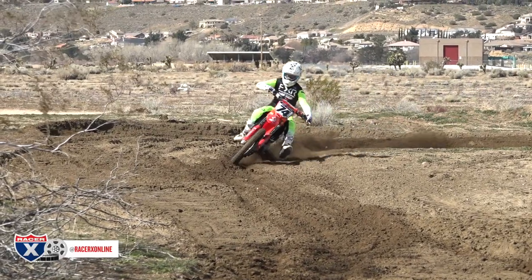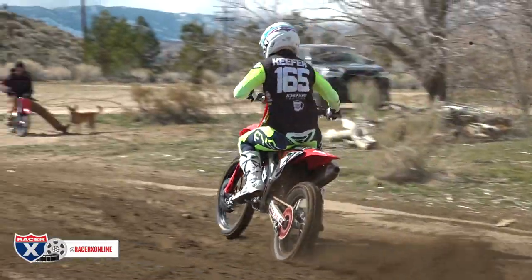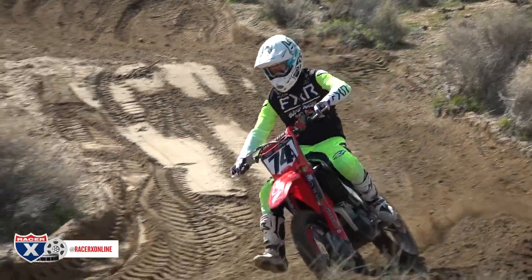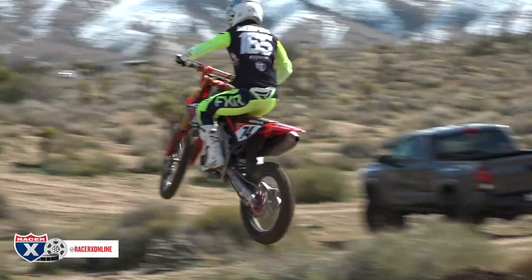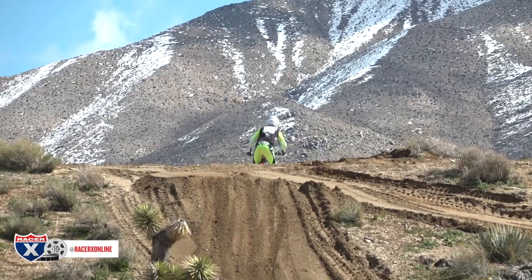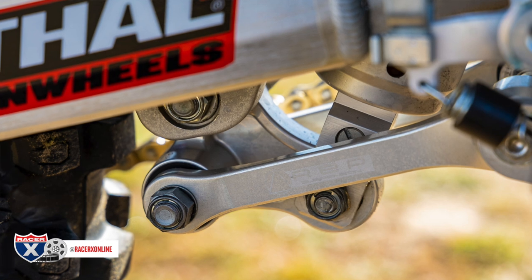I helped him out with suspension and we took his stuff over to Mark at REP. Mark builds a linkage system for this bike. If you're a Honda owner, you know that on square-edge hits it's very harsh — comes right up through the seat and you lose traction because it's always jackhammering your back. We call it GHB — Glen Helen Back — because every time you go to Glen Helen on a Honda, your back is sore for two to three days. Mark reworks the fork and mates the shock to a custom linkage with a more linear curve, paired with 23.5mm Ride Engineering split clamps. The result is more plushness, better holdup, and it doesn't hurt my back.